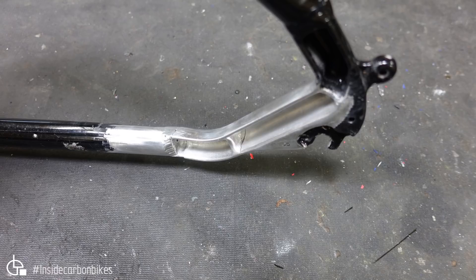It's been etched and a bonding adhesive primer has been applied, so it's all ready for bonding. Now, there are a number of factors critical to making this repair last. You get galvanic corrosion between aluminium and carbon unless they're isolated, so the first layer that needs to go down is actually glass fibre. That acts as an insulating barrier which isolates the two dissimilar materials, preventing galvanic corrosion.